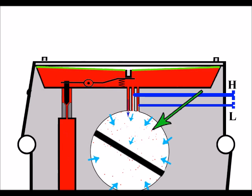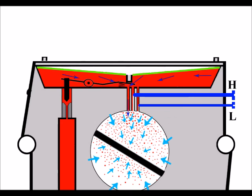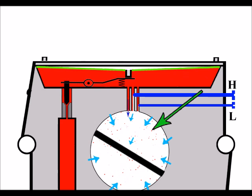So there's less available each time the piston needs to combust. And of course, eventually, there's just going to be that little that they'll be bogged down. That's if the engine runs to this point at all. Just to recap, this is a healthy diaphragm, so everything's well here. And this is again one that's gone rigid, so this is the unhealthy diaphragm.